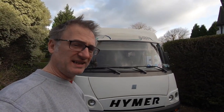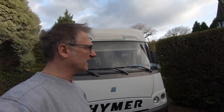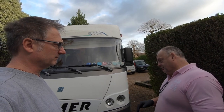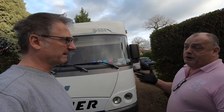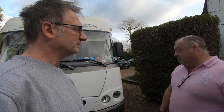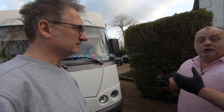So we're back from our test drive. Driving Herman seemed to be okay, you know, braking. It does seem to be a lot better than before. What do you think though, Chaz? Yeah, well, Herman, in my opinion, when you put the brakes on, he wasn't braking evenly and he was a bit snatching. You could feel that, couldn't you? Yeah, and on a couple of the corners. Now he's done the rear brakes, the braking balance is nice on it now, the bias is equal, I believe. And he does stop in a nice straight line now, and he dips where he should do, no drag, no noise, handbrake's much more efficient, much better pedal efficiency. That's the way I do it, and that's the way we've done it.